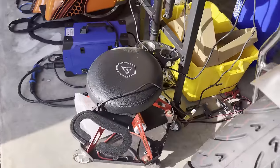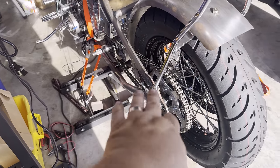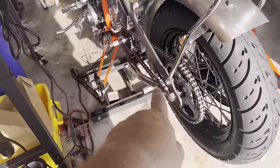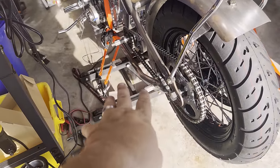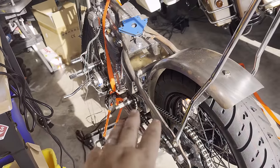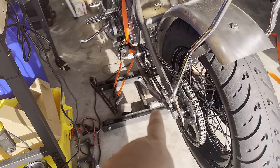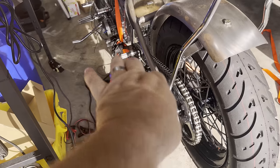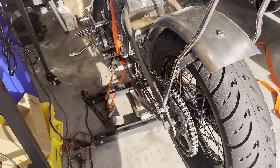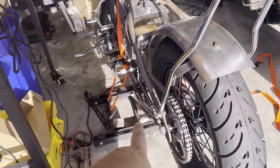What I did yesterday was mount the post I need for my taillight and license plate mount. That peg right there — that post — I welded it all the way around to the frame. There's still some work to be done to it, some shaping. I can't use Bondo — there are certain kinds you can use for powder coat, but I don't want to. It'll crack sometimes, and it's all about it looking good in 15 years. That is the peg that the license plate and taillight mount are going to go to. I've always loved that side mount look — your taillight and license plate just mounted to the side. I had to add that peg to give it a place to clamp onto.